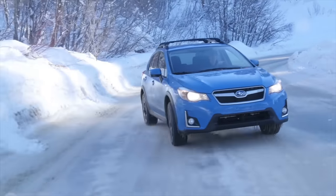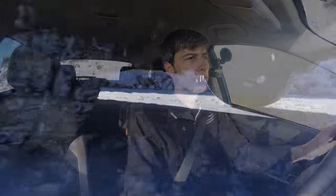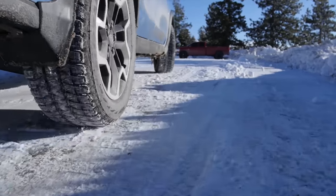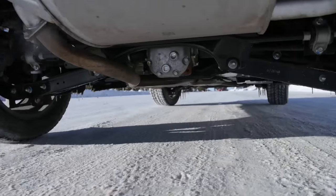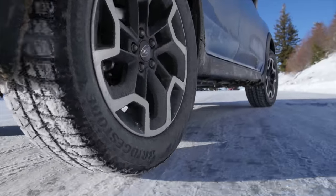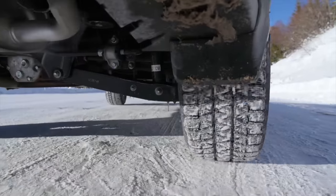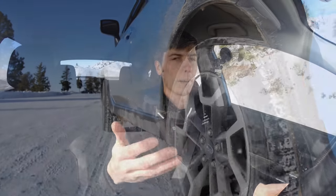One of the things I wanted to talk about was how the all-wheel drive system in this vehicle works. Subaru manual transmission vehicles tend to have a very similar setup for the all-wheel drive system. You've got your engine torque split 50-50 through a viscous coupling to the front and rear axles, and then there's an open differential in both the front and the rear. If one of those axles starts to spin up because it doesn't have traction, that viscous coupling — a purely mechanical device — will send torque to the other axle which has more grip, with no electronics involved. It can shift that torque ratio to maybe 80-20 or 70-30 to the axle with more grip.